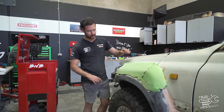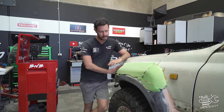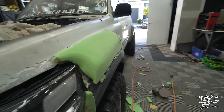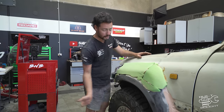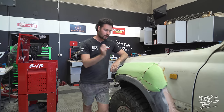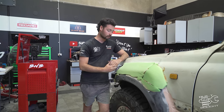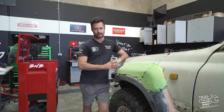There is a lot of experimentation going on right now. Shaping this is pretty tricky — I've done the bulk of the shape and just need to keep playing with the front bit where the headlight is. The trickiest bit is that the foam they gave me was an odd shape so I've had to add bits and join pieces. I'm going to get the resin mixed up and start putting the matting on — want about three or four layers: resin, matting, resin, matting, building it up to bridge gaps and blend into that existing fiberglass flare, then finish with fiberglass filler or metal filler.